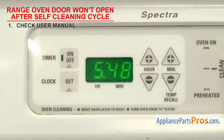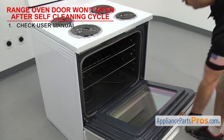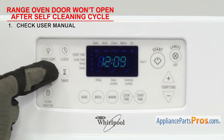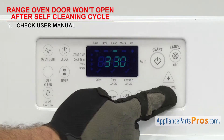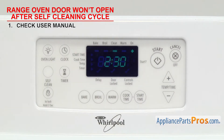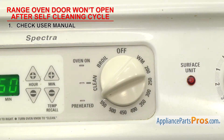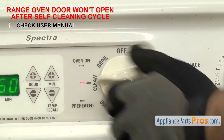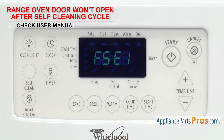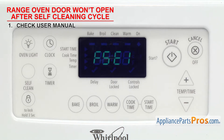If it works, the door will unlock. If not, as long as there's no food in the oven, restart the cleaning cycle for a short cycle — 15 minutes to 2 hours depending upon the manufacturer. Let it cool down again to see if the door opens. If you have the older style oven with knobs to turn, make sure they haven't been moved from the self-clean setting, as the door may not unlock if the setting has been changed. Do not try to continue or restart a self-cleaning cycle if there are any error codes displayed.